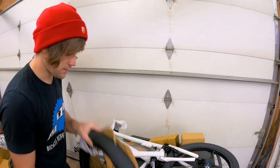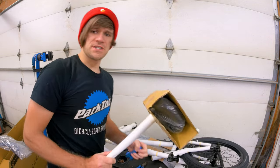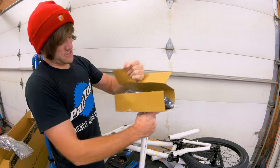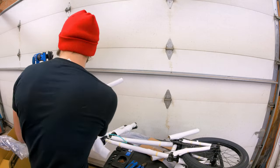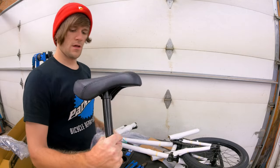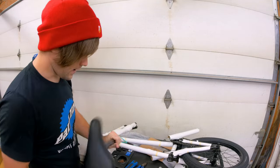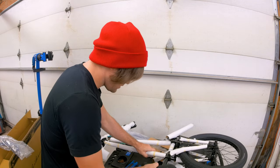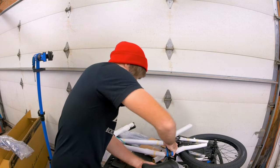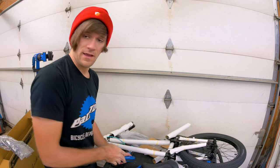Front wheel separated — I'm going to set this aside. There are actually already brake cables on here too. The first step I'm going to do to make this easier is installing the seat and seat post. This is kind of a how-to for building a complete bike out of a box as well as introducing the series. The seat that comes on this is a Fit seat that is a combo with the seat post, and I'm just going to slide it in and tighten it with a six millimeter Allen. Very easy.